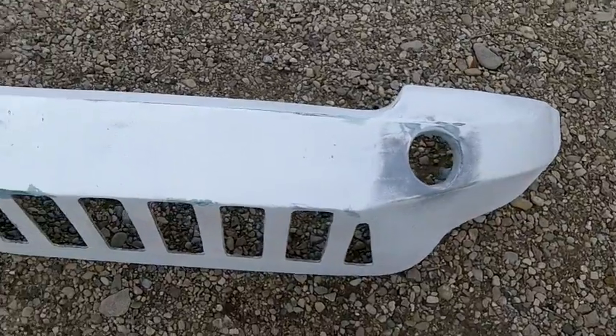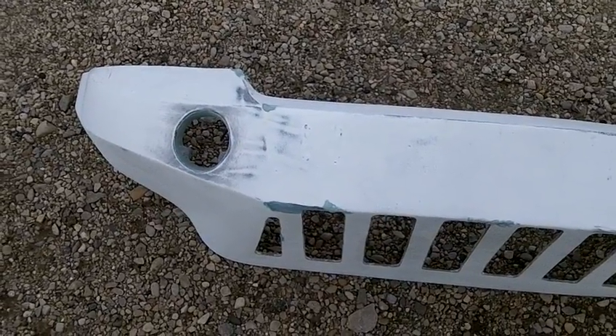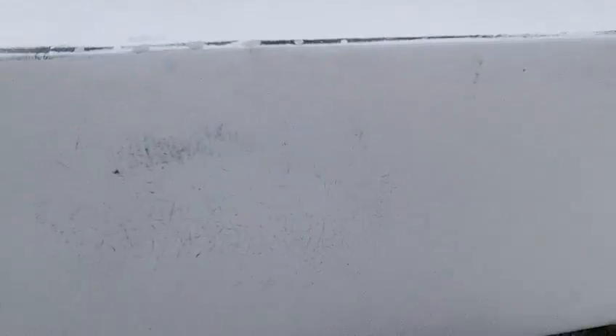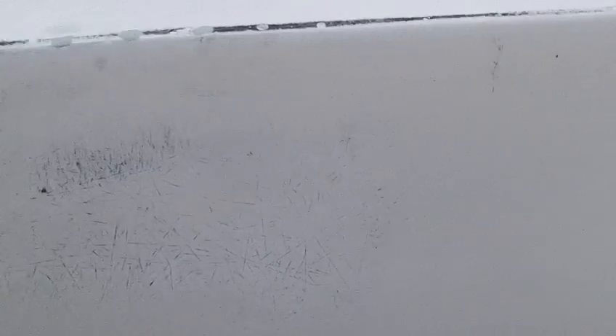This is my first cast bumper — it's a quarter-inch thick hand-laid fiberglass. My first layer was three-quarter ounce and then the next five layers were two ounce. I'm guessing it weighs about 30 pounds — I can hold it out in front of me, so it's not ridiculously heavy, but at a quarter inch thick it's very strong. It mounts on the front of the winch bracket with the D-rings bolting through it to hold it in place. I've still got to cut a little hole for the fairlead so it's recessed in the bumper and looks more flush.